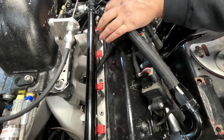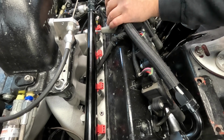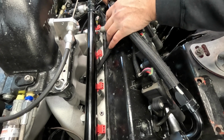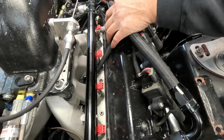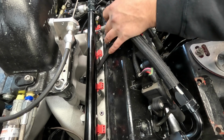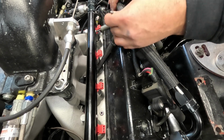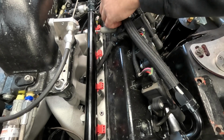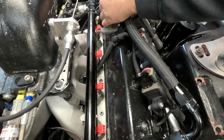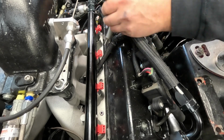He's doing big injectors. They got, oh, what do they got? 400, 600, and 800 pound per hour, I believe is what they got right now. Low impedance, obviously. And if you're running a Holley, technically you should be able to run them off the injector drivers in a Dominator, but everybody I've talked to recommends getting the external injector driver. So that's what I did. So I got to wire that in.